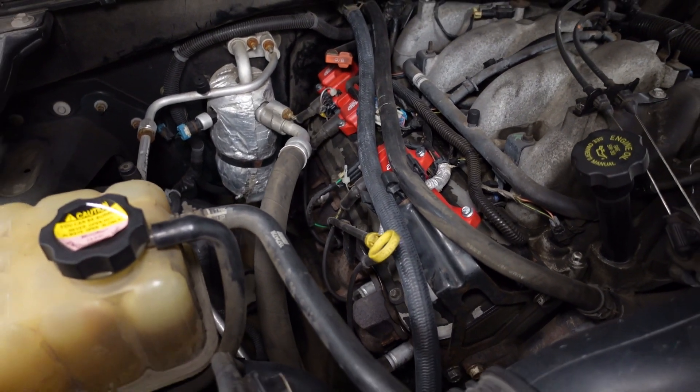There are no off-the-shelf options when it comes to turbo parts for an 8.1. I've seen a lot of guys do a remote-style turbocharger mounted under the bed, but I don't like that option because there are a lot more complications when it comes to plumbing the oiling system and more opportunities for failure. I prefer a high-mounted turbo where the oil can be pressurized in and gravity-drain back down to the pan. Because of how tight it is on the passenger side of the engine bay, we're going to have to get custom. A log-style manifold is how I'm going to run.